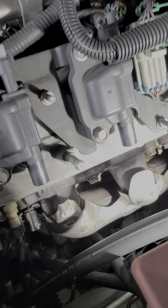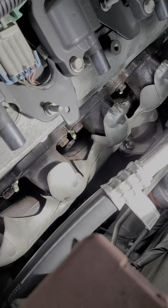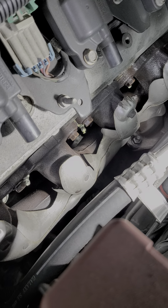We got all the bolts off of this side of the headers. We loosened some of these — PB Blaster is really good for that. You can see how they're kind of rusted in place. I got the PB Blaster right here — always get yourself two cans.